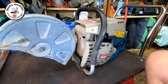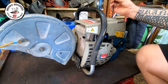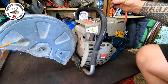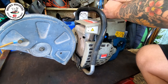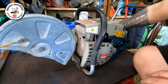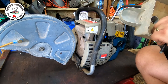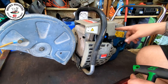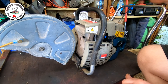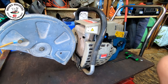Here it is — the little Makita. I have some spare bits: some spare filters, a carburetor kit, new fuel line, and that's about it. I have had a little look at it. These don't generally run very well if they don't have the correct filters in them. As you can see — zero filters. There should be a filter at the top here; there's one filter there which is cool but well used, so we'll take that out. There should be a screen there as well to stop any dust going into the carburetor.